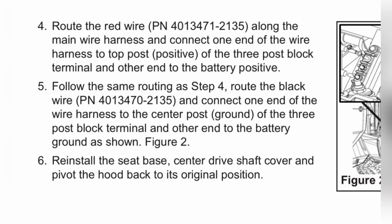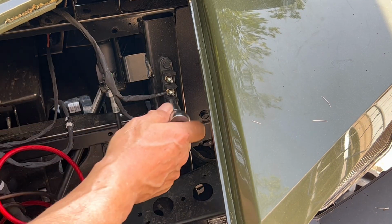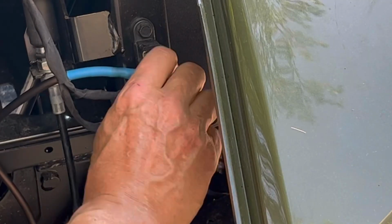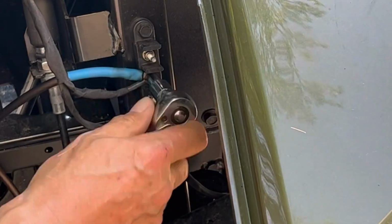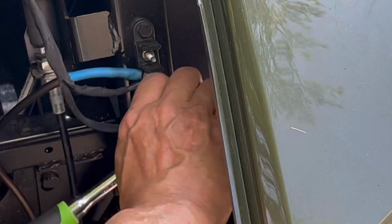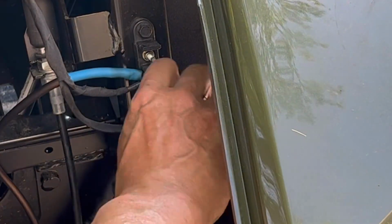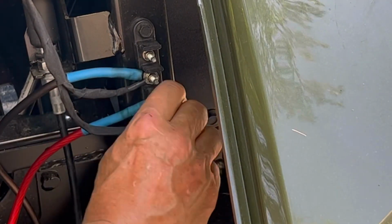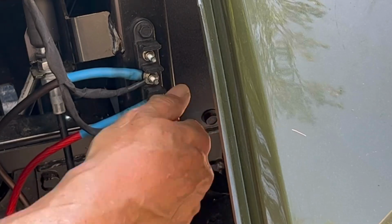I was able to download these instructions that come with the Polaris Busbar wiring kit if you choose to purchase it. Okay, so this is 5/16. This was before I realized the dealer had hooked a positive lead to the negative post. I traced that center wire and corrected it.